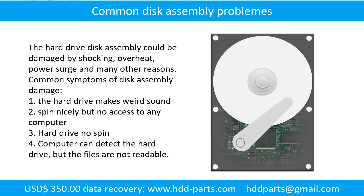If the hard drive disk assembly is damaged, we can do disk data recovery to recover the data from the disks. The common symptoms of hard drive disk assembly failure are: 1. The hard drive makes a weird sound. 2. It spins nicely but no access from any computer. 3. The hard drive does not spin. Tips: if the storage is configured as mirrored hard drives, you can take the bad hard drive out, put in a same-size or larger hard drive into the bay, and the storage will mirror the data to the new hard drive automatically. If this trick doesn't work, that means both mirrored hard drives are damaged, or the storage was configured as RAID 0, which means the two hard drives contain different data.